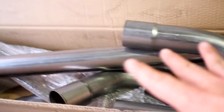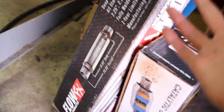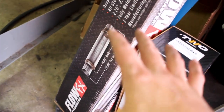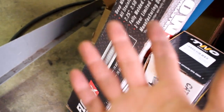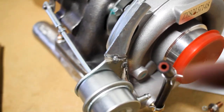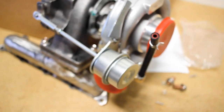Some of the other things I got: a nice little Chinese Amazon catalytic converter, and I decided to go all 2½-inch. Everything here is 2½-inch. This is a cheapy Flowmaster — I kind of like the sound from the videos even though they're on a lot of V8 vehicles. I thought this might give it a little more of an American sound. So let's plug her in and get the welding going. Got it tack welded up with a tack here and here, and nothing seemed to shift.